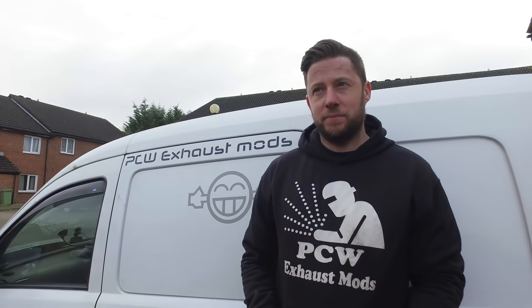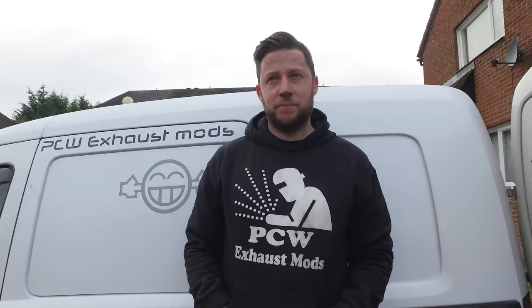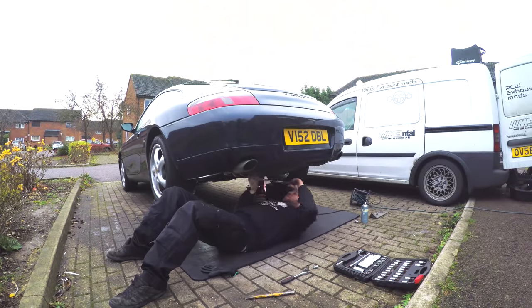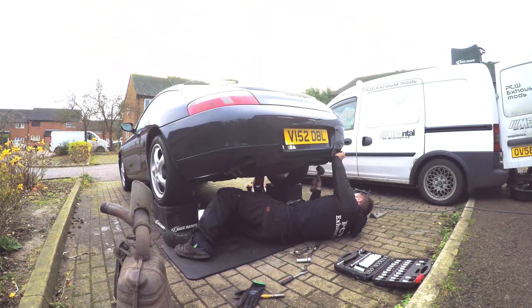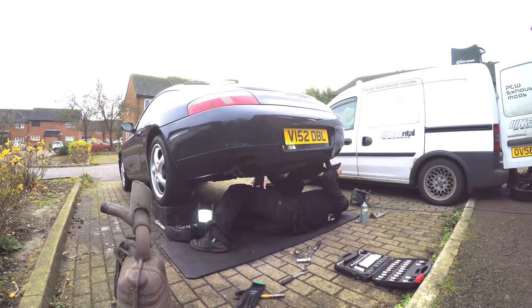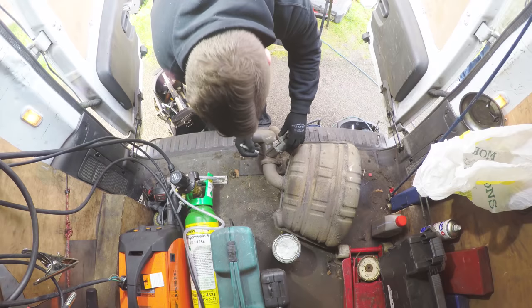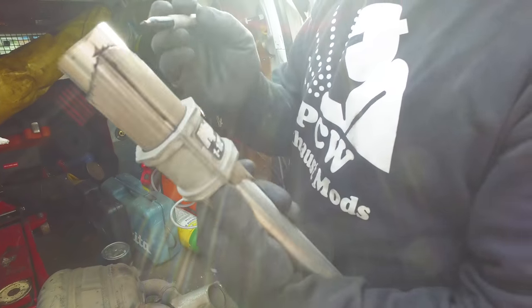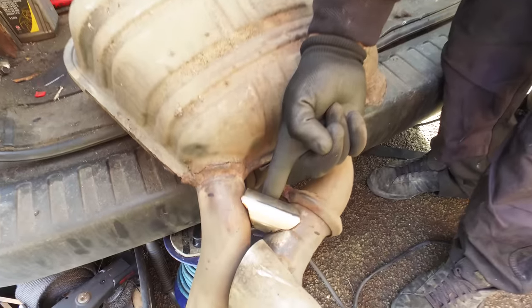This is Paul from PCW Exhaust Mods, and he will come to your house and do this mod on your car while you wait. The process starts by jacking up your motor and removing the standard exhaust, which can sometimes be problematic if you have seized bolts. For Porsche 996s and 997s, he then uses a special tool to measure up a bit of stainless steel pipe to create a muffler bypass between the inlet and outlet pipes.